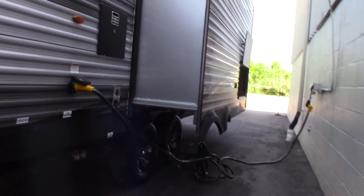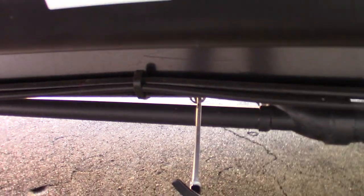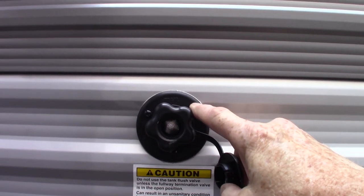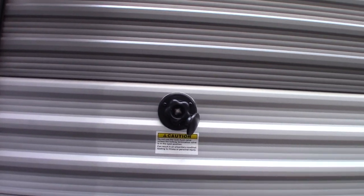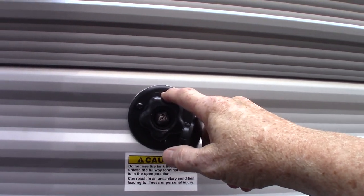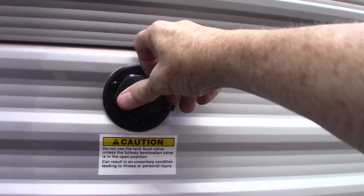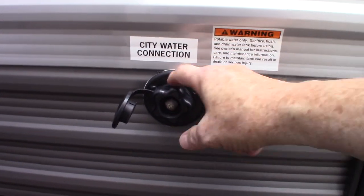This is your dump hose. You have valves here — that's the gray valve for the gray tank. This trailer has two gray tanks. Then of course the black right here. The gray is sink and shower water; the black is toilet water and waste. After you've dumped your tanks, you can leave the black valve open and come up here to put a hose at the dump station right onto this fitting — turn it on and it'll spray the inside of your black tank, cleaning the sensors so you get a good accurate reading.